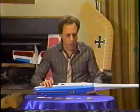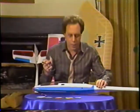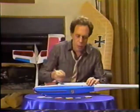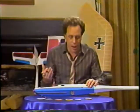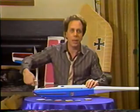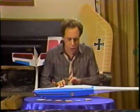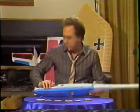Now what I'd like to explain to you about what not to do is taking a rather large quarter inch pinstripe or even a 3/32 or an 1/8 inch pinstripe and placing it directly over a color seam. What that's going to do, even though the workmanship underneath it may be flawless, it's going to let people think that you've cut a cockeyed line and now you have to use a big, fat, ugly trim stripe to hide that seam. You'll find it flows a lot nicer with a thin stripe. The little separation lets everybody know you didn't cut it sloppy and you cut it real pretty.